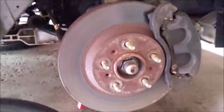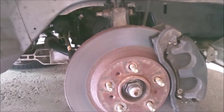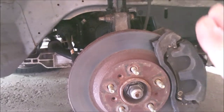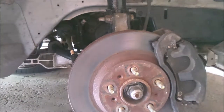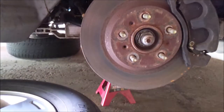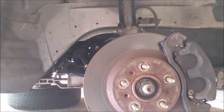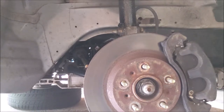Here we go. The side I just worked on, the stupid bearing that I got from the boneyard is bad. I'm just glad they didn't charge me for it. I think while I'm at it, I'm gonna try to tip the camber a little bit. And then hopefully I'll set her on the ground, and I'm gonna do a string alignment. Maybe I can get this thing close so I don't need to take it into the shop.